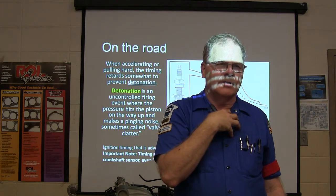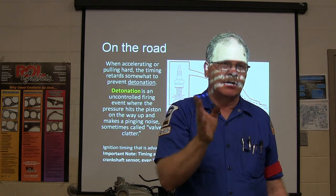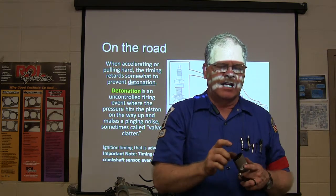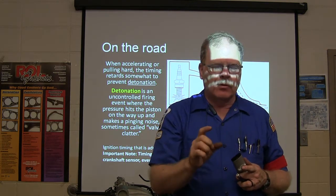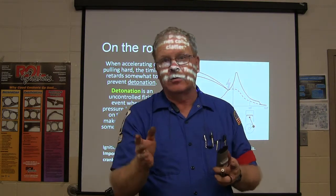Well, what we did on the Mercedes, well, it was actually a Crossfire here. We put a crank sensor on it because it'd get hot and the crank sensor would open up. Yeah. And the sensor that came out of it had 1,050 ohms. The one we put back in had 1,350. It was an Intermotor brand. I'm sorry, Intermotor, but this is the way it was.